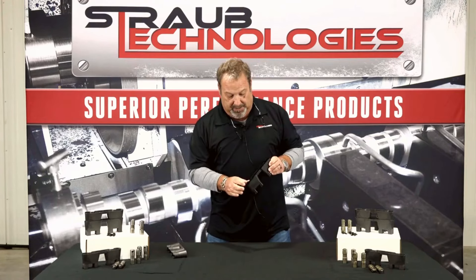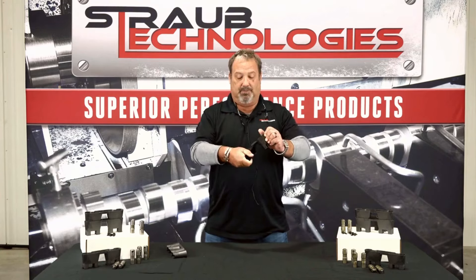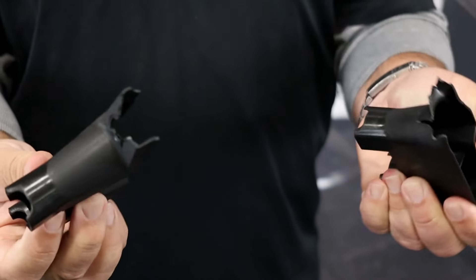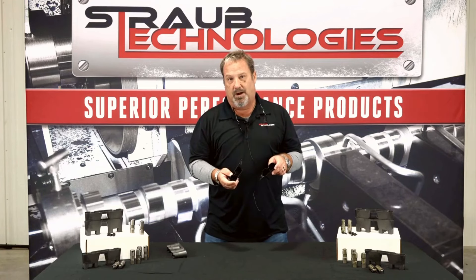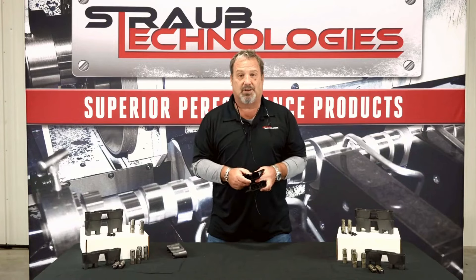You take this import piece with the fewer gussets — note there's no part number on the import piece. So if you buy this somewhere and it doesn't have that GM part number, and the gussets down here aren't much, but you saved yourself $15, you could cost yourself $15,000 in engine damage.